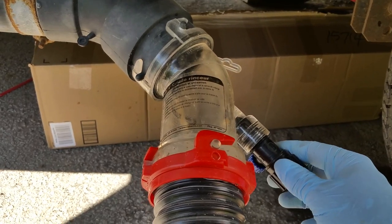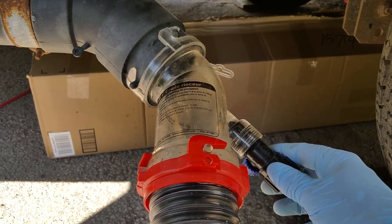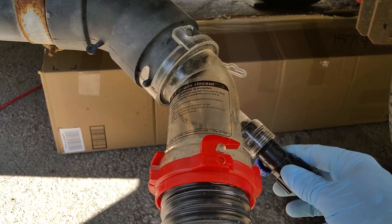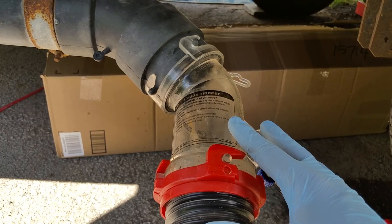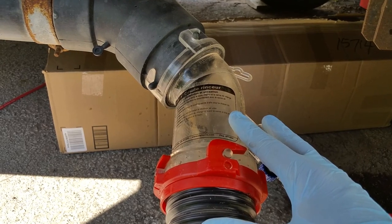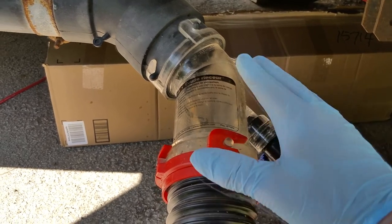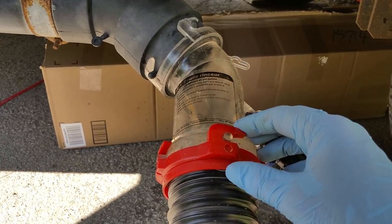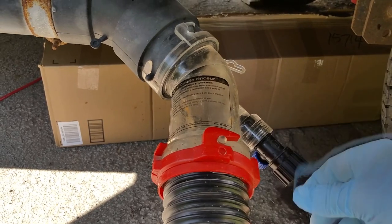The reason this happened, I think, is because we had the black water tank valve open continuously for months — and I've read you're not supposed to do that, so lesson learned. About 24 hours ago, I put about a gallon of drain cleaner down. That didn't seem to do anything, but it's something that might have helped. I let that soak in there for about 18 hours along with added water, since we noticed it was clogged because nothing more was coming out. Then I took about four or five times — I'd put the snake up there, get a release, then it would stop. Put the snake up there, get a release, then it would stop. I had to repeat the process four or five times, but finally it's running good.